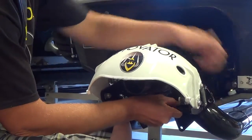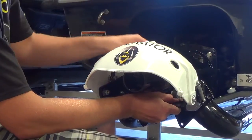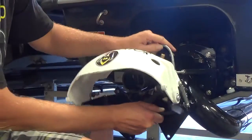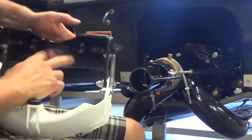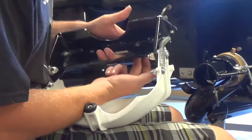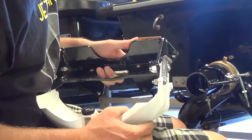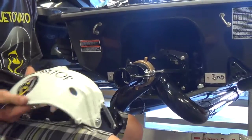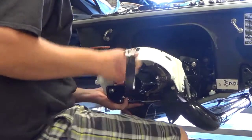We'll put the bolts in here, two on this side, two on this side, and then this thing just slides down in here. And there's a couple of holes right here that those slide down into. There's a lock nut on top, and then the nut that you tighten up to actually secure it down onto the thrust adapter itself. I'm gonna go ahead and put it on real fast, and then we'll show you how to get the linkage rod on there.